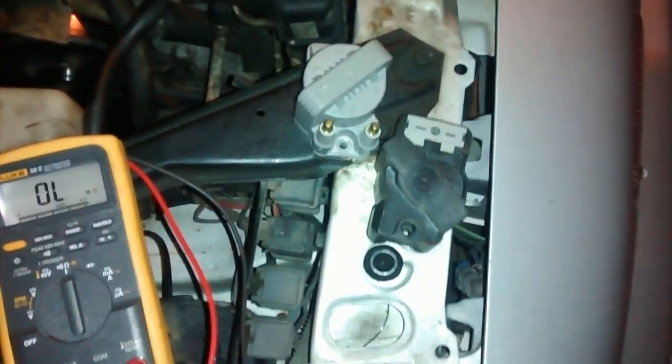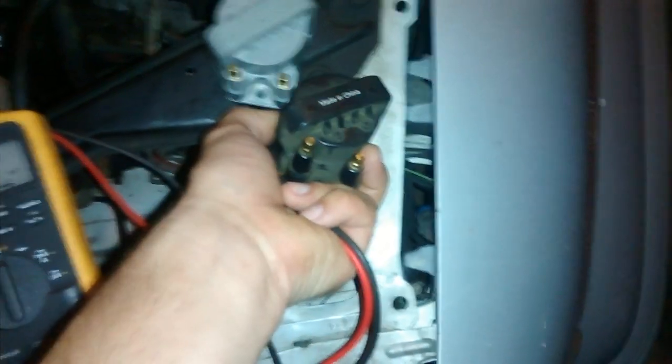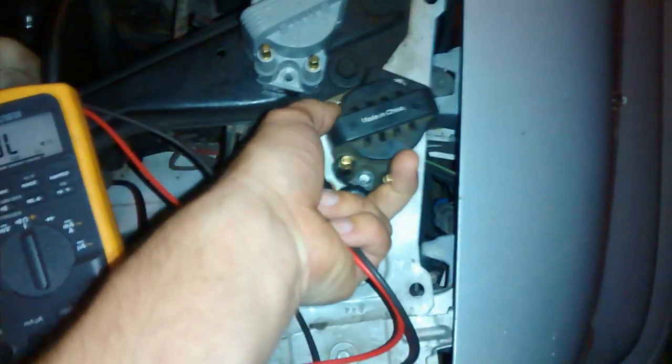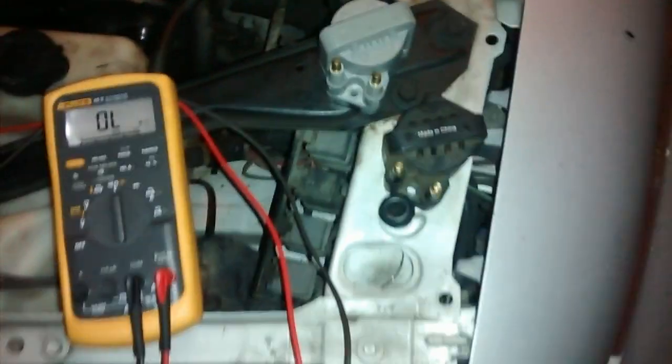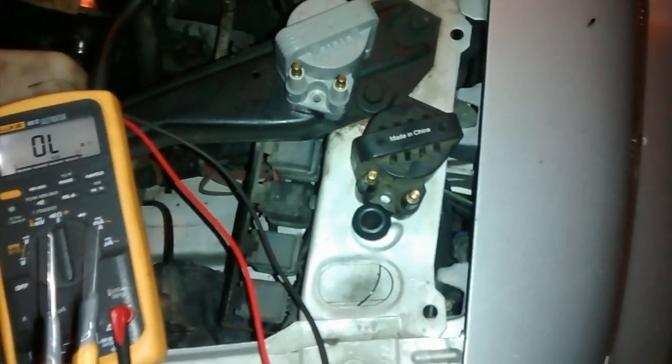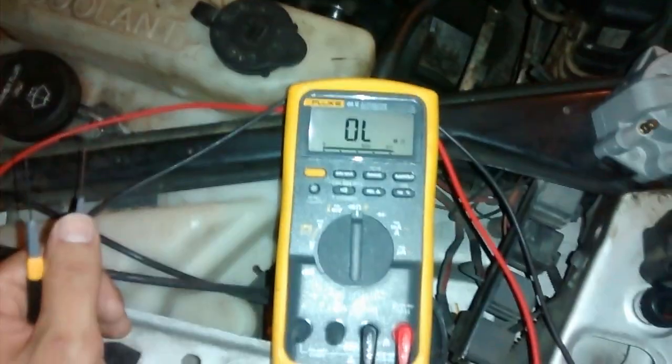But I don't think it would necessarily be the best idea. What I'm going to show is how to check your coil packs to see if they're bad, though it doesn't necessarily rule out intermittents just because of the way intermittents are — a short happens at random times. So what you do is you set a meter on ohms, and this is checking the secondary coil.